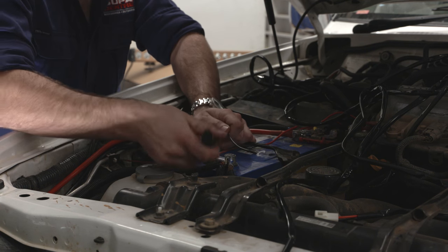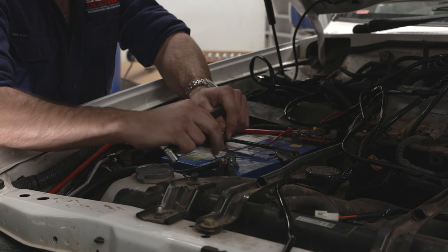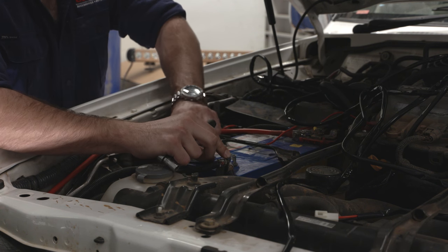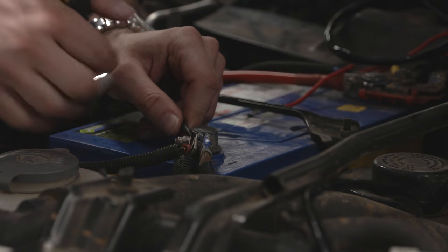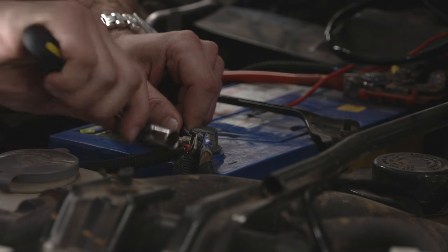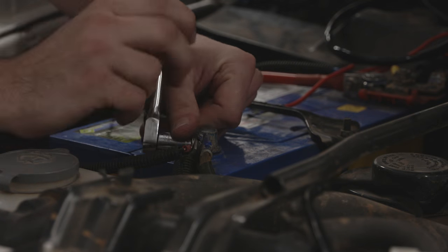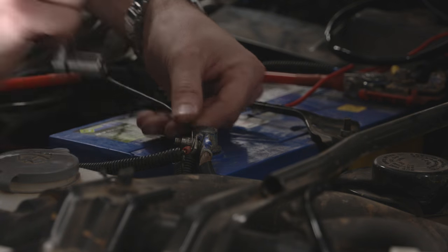First, hook up the negative wire — that's the black one — to the negative terminal of the battery. Don't just put it anywhere; make it look neat and tuck it out of harm's way, then make sure it's solid and not going to vibrate loose. You don't want wires to loosen and fall off when you're relying on your lights on a dark track, or worse, short out and spark. Even with the fuse removed, you can leave the red positive wire disconnected for the moment, but just make sure you've left enough length to reach that positive battery terminal.